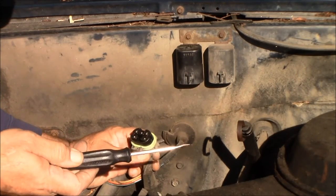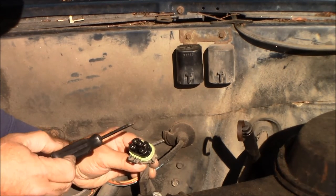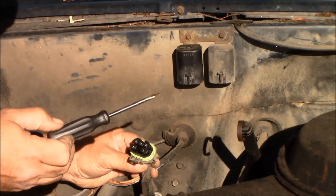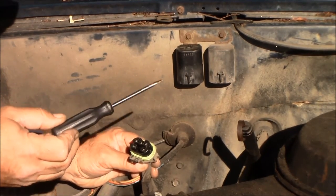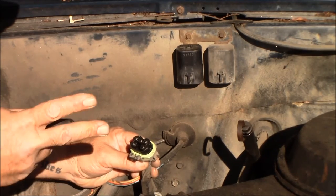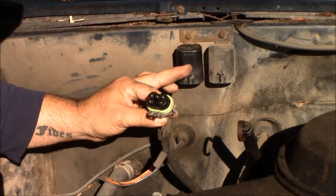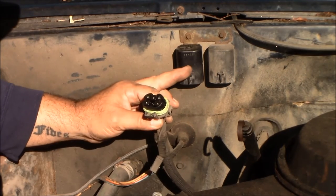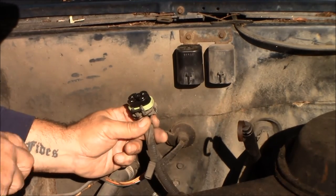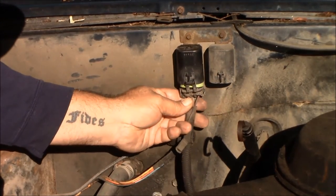You can check it with a test light: probe for ground on one side of the switch and probe for power on the other side when the ignition is turned on. You've only got two seconds to do it, so use another person - they hold ignition off for at least 10 seconds to let the system reset, then turn the ignition on while you probe. If your test light lights for the two-second prime, your wiring is good and it's the fuel pump relay that's bad. If you have a known-good one on the shelf, just swap it in, turn the key, hear the pump prime, and you know the relay was the problem.